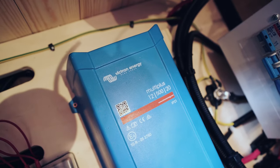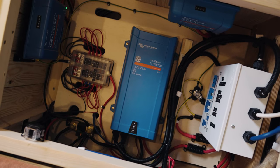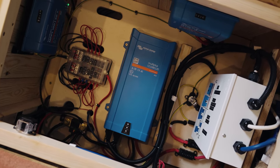On board this vehicle in particular, you have the Victron Multiplus Inverter. It gives you a 900 watt maximum output power and 430 watt continuous power. The lithium battery on board is 220 amp hour. That is a ginormous amount. I would say personally, I've got a similar setup in my van and I can go off grid for 3-4 days. If it's a nice day like this, I mean, indefinitely with regards to power because you're harnessing the UV rays.